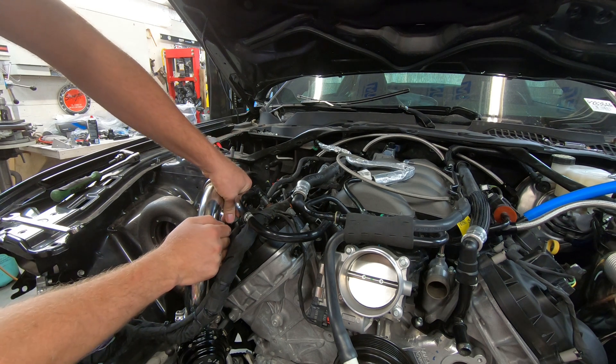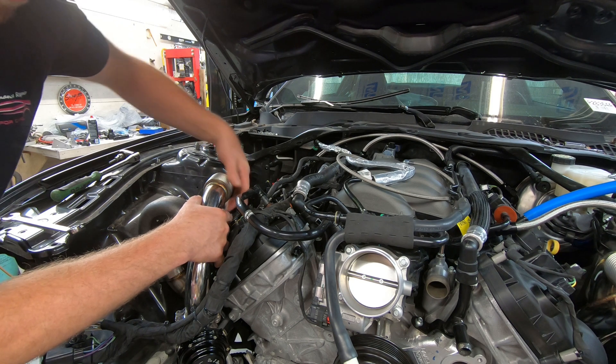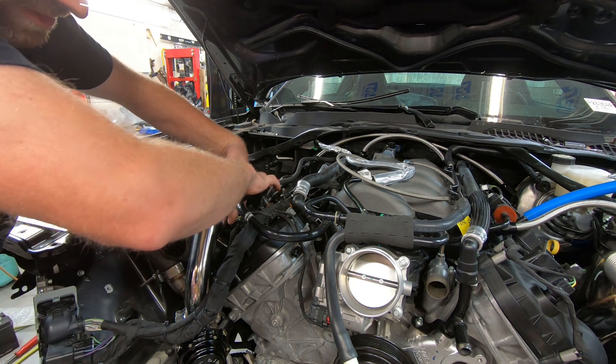One of the reasons I like that pump is it's a lot quieter than an actual vacuum. We're going to go ahead and pop this cap off just to verify that I have pressure in there. You see it actually blew the cap off — I did not do that at all. I'll push it down, hold it with my finger, let go. See how it blows the cap out of there? That tells you that you have good pressure inside the crankcase.